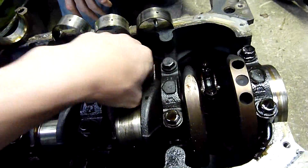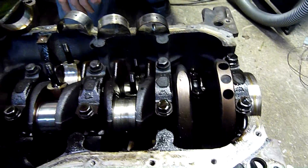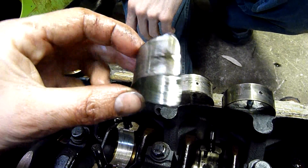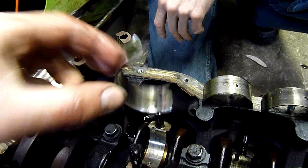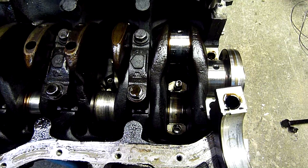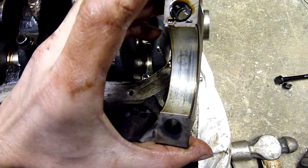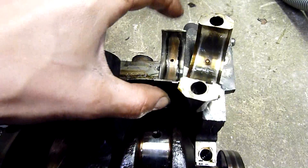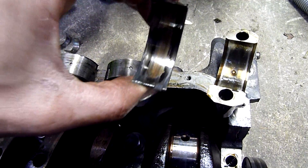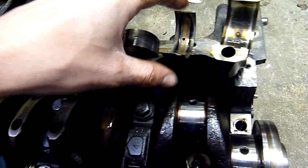God, this oil is sticky - heavy oil, almost like gearbox oil. Number four, being last in the order of oil delivery, has just been completely starved and burnt, started burning up. It hasn't spun, but it is just burnt black. The oil residue on it has just carbonized.